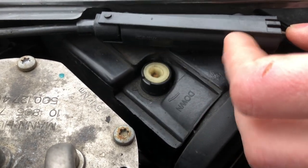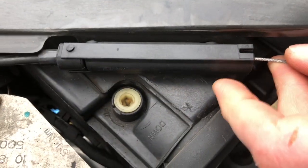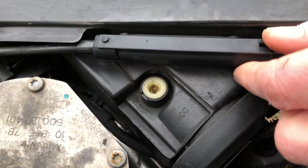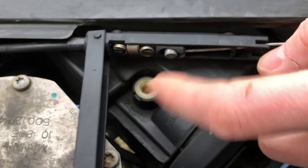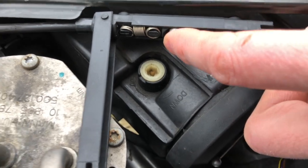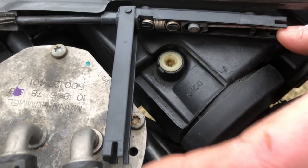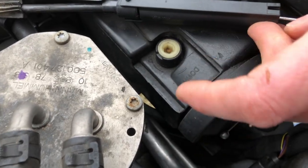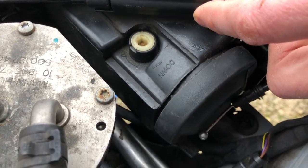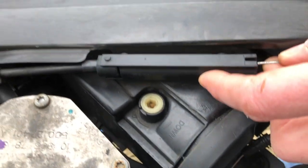This is what you're trying to achieve: either with a spare cable or with this cable, get it seated in there and then get that cover shut — that was the important part. I tried doing this a few times without closing the cover, just by seating it in there and pulling, but it pops out very easily and trying to hold it with my finger wasn't enough. The mechanism is quite stiff with quite a lot of resistance. So close up the cover, then with your pliers give that a good pull, and for me that was enough to pop the bonnet and get underway to getting it fixed properly.